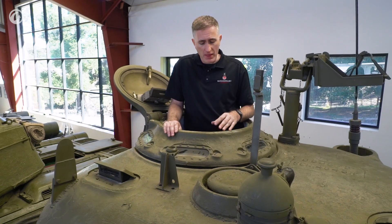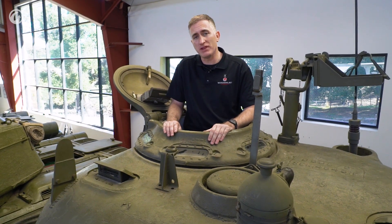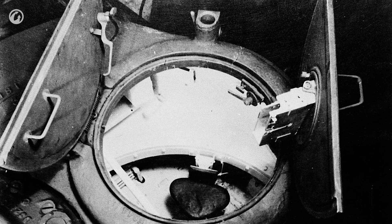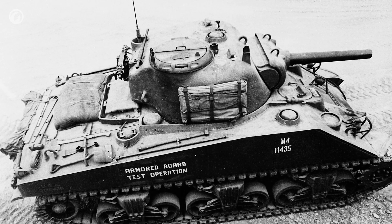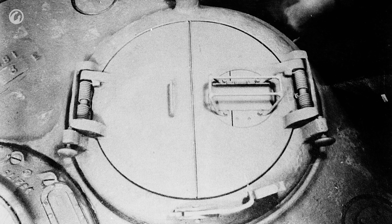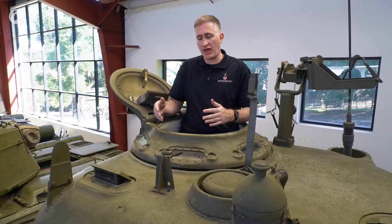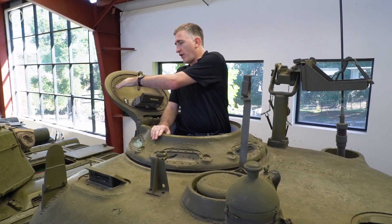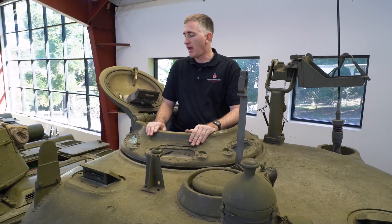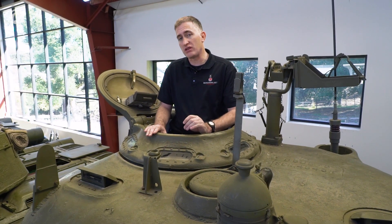Other features around the turret — speaking of hatches, this is not the original hatch that came with an early 75mm tank. This was originally the split hatch: simply two pieces of metal that came up, with a single rotating periscope in one of them. Very unsatisfactory. It also had a mount for the caliber .50 on the ring. What turned out was that the vision cupola was the same diameter as the split hatch, so it was easy to swap it in — and all of a sudden you have a much better hatch, now with an azimuth ring and periscope.